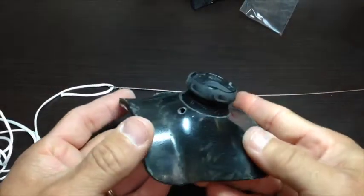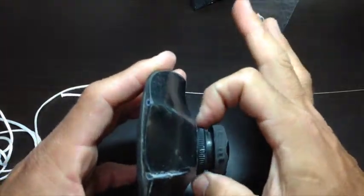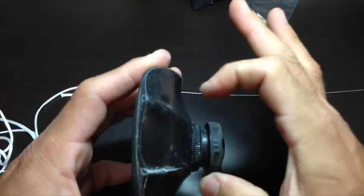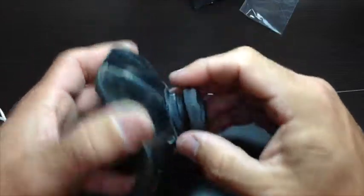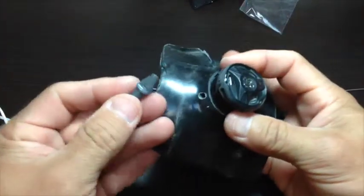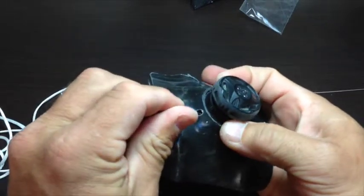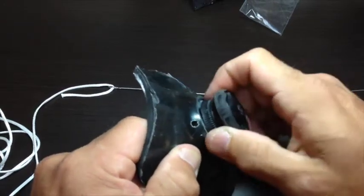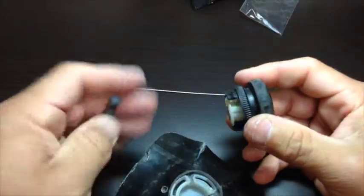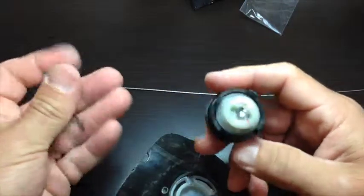On the existing item, we first have to unlock the dial from the housing. The dial has an outer knob and an inner lock ring. We're going to take the Torx tool, push it into the unlocking hole, push in, and rotate clockwise. The lock ring will give a little bit of a turn and then the dial will come right out. The push tool pushes these little locking tabs out of the way, which is what allows it to unlock.